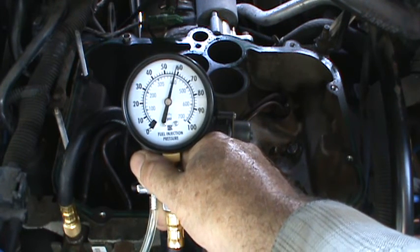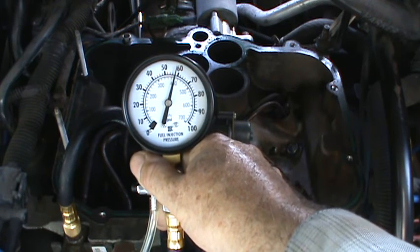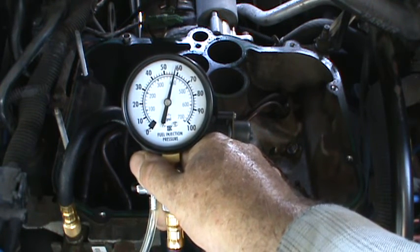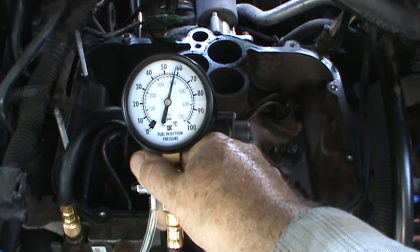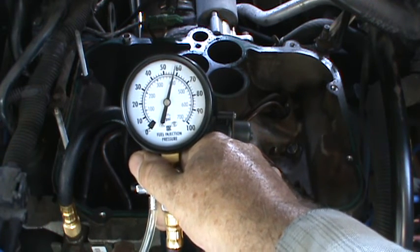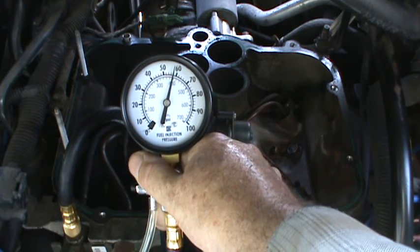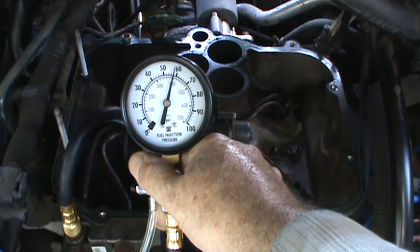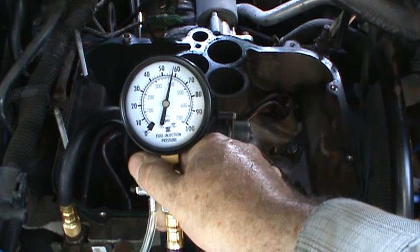She's holding just over 58 psi after all that time, and I don't see any leaks. Once I shut the camera off I'll collect my tools, look around for any leaks, and leave this pressure holding as long as it wants to. I'll monitor it a second time - I did it the other day after putting in the new fuel pressure regulator and didn't see any leaks. There you have it for this video folks, thanks for watching. Till next time, be safe, take care, have yourself a good one, bye for now.